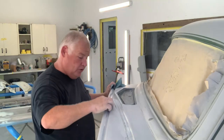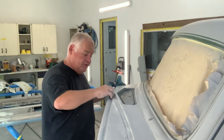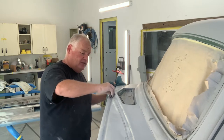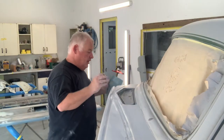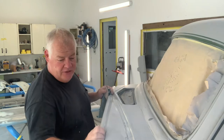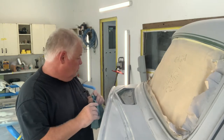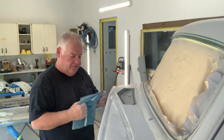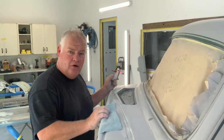I'm getting down into all the grooves, blocking it down really nice. I've got a roll of paper here rolled up and it's 320 grit because it's going to get primer again. It's not going to get a high build primer this time - it's just going to get more of a primer sealer type coat, just to cover up some of the bare metal spots on some of these edges that I've sanded. You want to address all these problems - you don't want orange peel, you don't want to put really nice shiny paint in there and find out you've missed something. So run your fingers in there, see if there are any rough spots, anything that you missed.